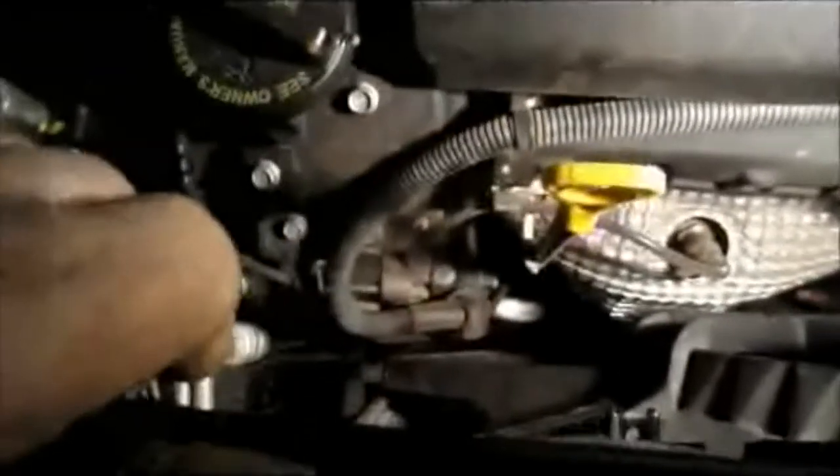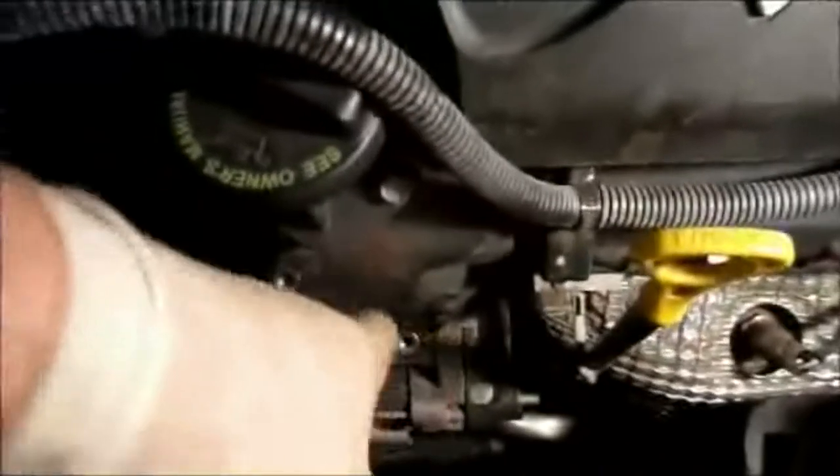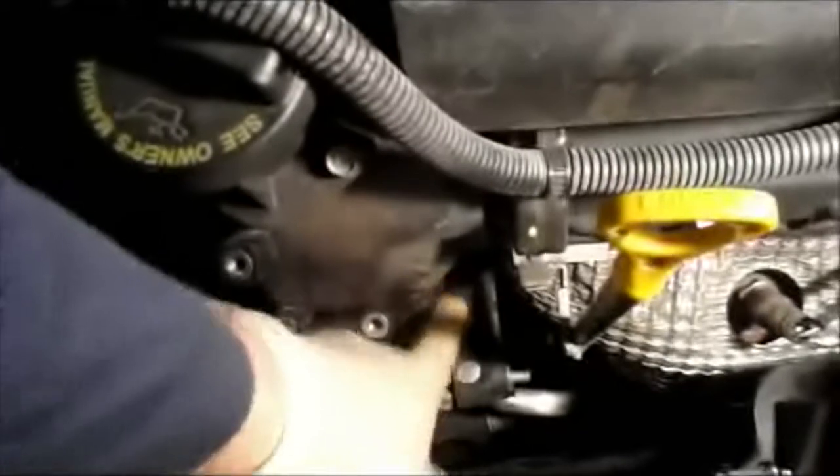This is what it looks like with the hose out of the way. We're going to disconnect the upper bolt on top of the alternator — that's a 14 millimeter — and remove the electrical connectors. I also disconnected the oxygen sensor to clear the area, and removed two brackets holding the electrical wiring in place. Now we're going to try to get this alternator out, hopefully sliding the fan over enough to pull it through. It's actually unbolted but pretty tight, so I need to get in there with a pry bar and pull it out.